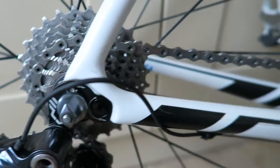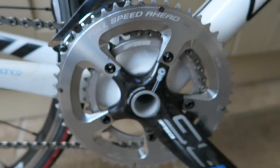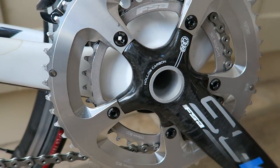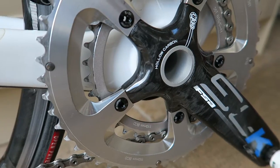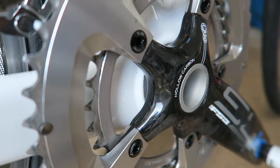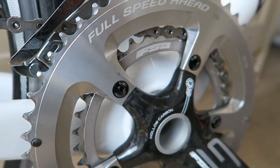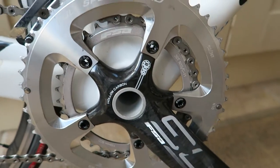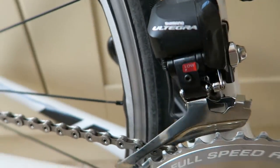Once it's been washed and dried, it's been sprayed over with GT85. The front cranks were taken off to check the bearings on the bottom bracket — they were fine, just re-greased on the outside of their sealed units to stop water penetrating. They were running smoothly.